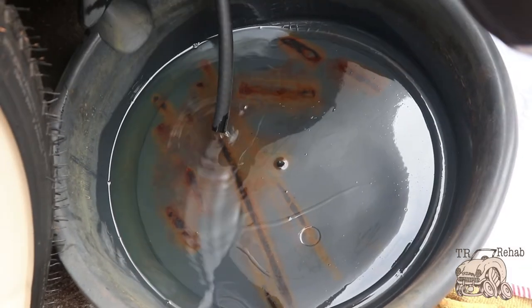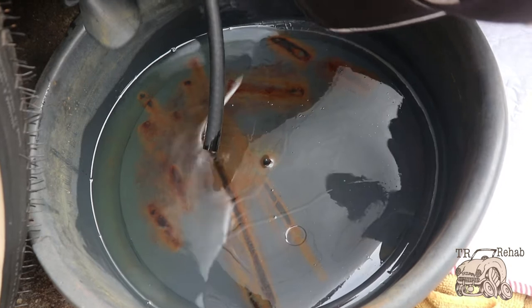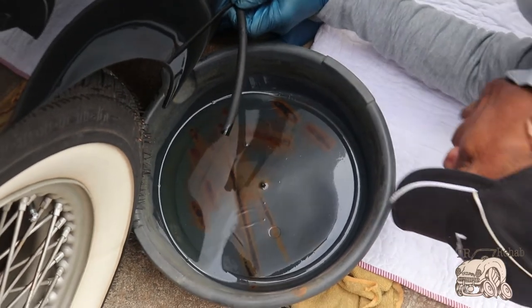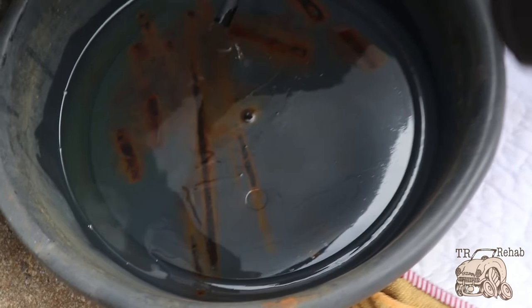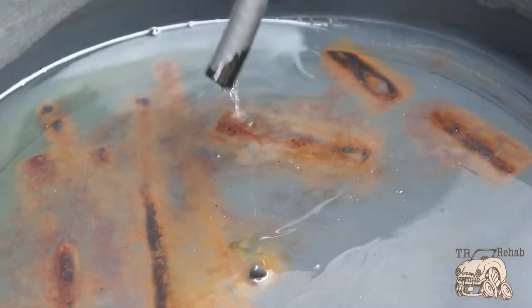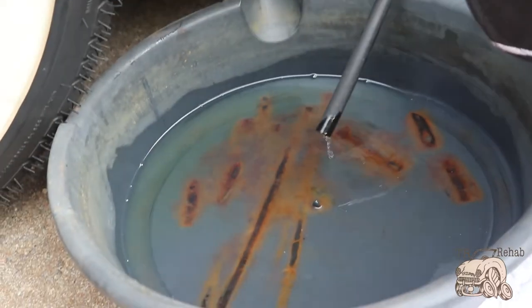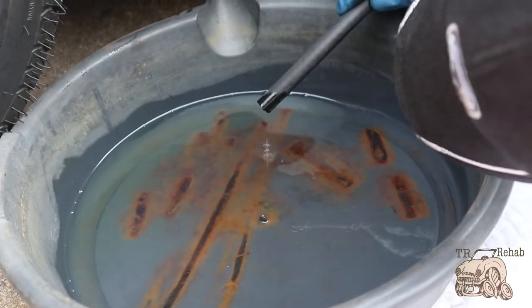With the old filter still on, I'm trying to see if gas flow from the tank up to the fuel pump is sufficient. It was brought to my attention on the Triumph forum that I could have a clog in the line from the tank, or it could be the vent tube. The test is to pop open the gas cap and see how the gas flows — this problem has happened both times right after putting about seven to ten dollars worth of gasoline in. With the gas cap open, I don't see much difference, so I'm gonna take those filters off.